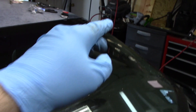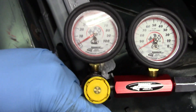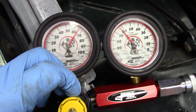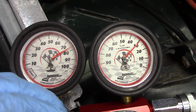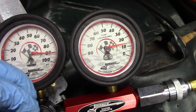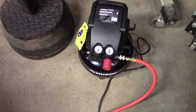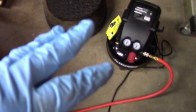Let me set this up and we'll try it out. All set up — got the tester hooked up and everything. I previously tested this rear cylinder and got five percent leak down using that compressor, so we should get similar with this. I'll have to dial in the socket when I turn it on, and I fully expect that compressor to kick on because it's only three gallons. Here we go — slowly crack the ball valve. Engine's actually turning a bit. Let me crank this up to 100. She's still turning a bit — can't quite get 100. I just let it fill up. I turned it back on because it appears to leak faster than this. The leak down on the cylinder was showing five percent — it's leaking down faster than the little compressor can keep up.